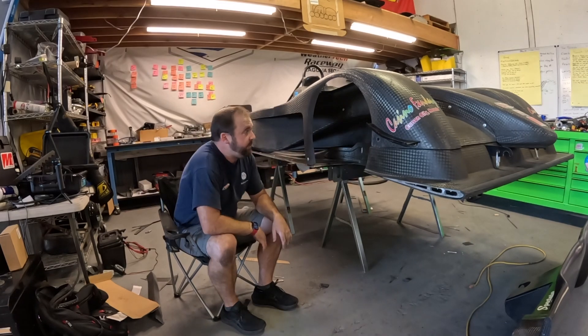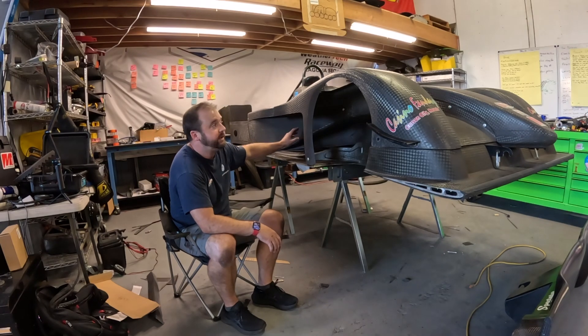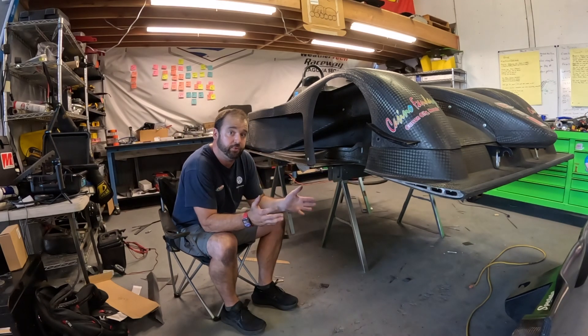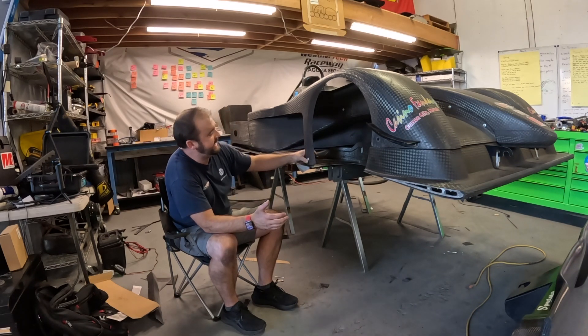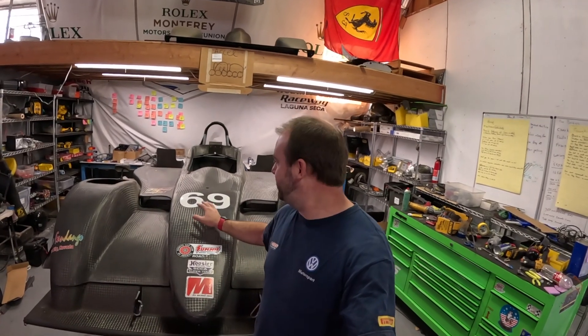So that's going to about wrap up our day. I'm going to continue it here in a little bit because tomorrow we're going to still have to do a lot of cutting to the actual carbon floor that we've installed. We've got to actually put clearances for the front suspension — there's one suspension bolt we have to put through, there's a recess on the outside portion we'll have to do, plus we have to completely go through the engine's diaper or the fourth piece of my floor and start marking out where we're going to cut the recesses to allow the lower control arm, the push rod, a little bit of the upper control arm, and the drive axles to actually come out of that part. But for now, we've got the body on and located with the side pods and the anchor points for the front fenders on the leading edge of the floor. All in all, I'd say it was a pretty darn successful day. Hit that like and subscribe button and we'll see you guys in the next video for round three with the cutting and trimming we still have left to do. Aloha and mahalo.